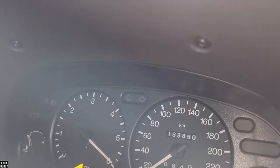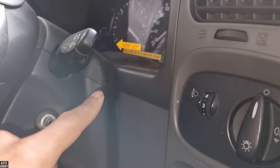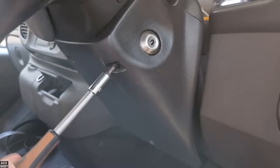In order to remove the speedometer there are a couple of screws up there — one there and one there — and there are another two hidden underneath. To get to those two underneath we have to open up this plastic trim over here on the steering column. Two ways you can do this: you can drop the column down by removing the four bolts, but once I remove all of this I'll show you how to do that.